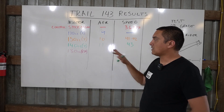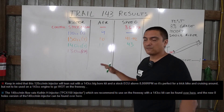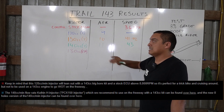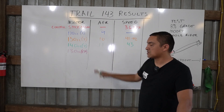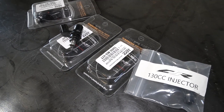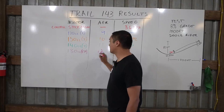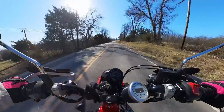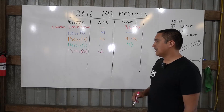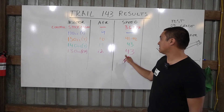After the 140cc test, I looked at Yumanashi's website again and saw that 120cc is fine for a stunt bike but not good for extended highway use because it'll lean out. So I didn't go with the 120. Instead I found a 130cc injector from Faster Minis — I didn't measure flow rates, this is just as stated by the manufacturer. With the 130cc injector we were getting pretty close to 12, around 11.8 to 12 depending on the gauge. But our top speed on the hill test? Still 43 — that was the best we could get.